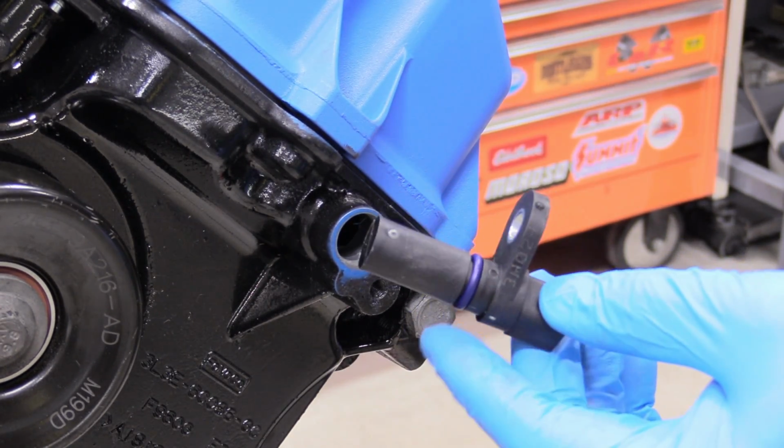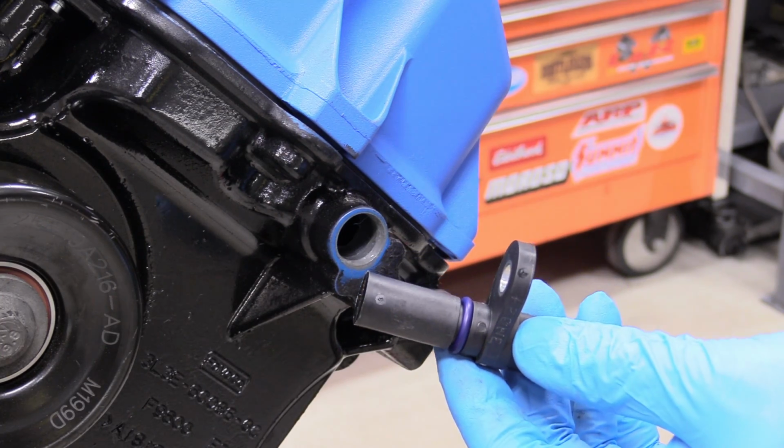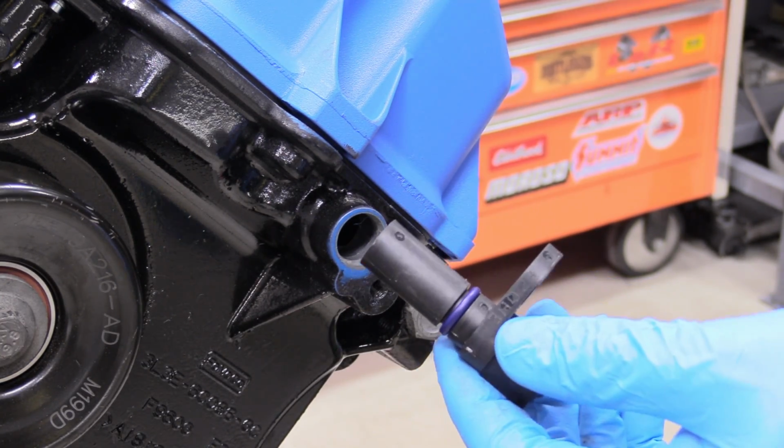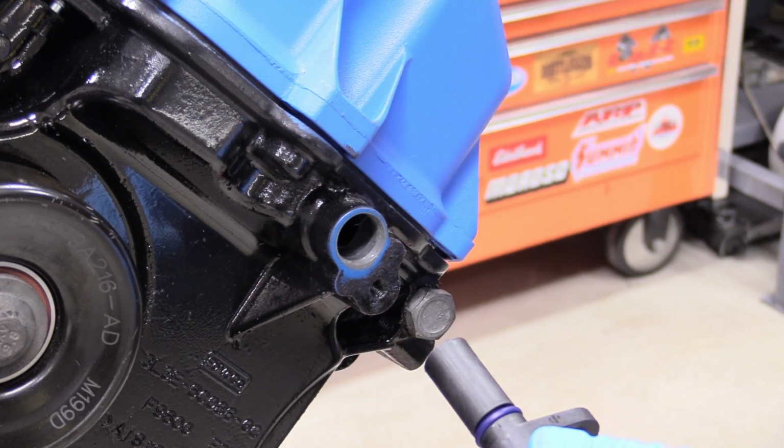So let's grab our old bolts and get to installing them. On this O-ring, the only thing protecting you from an oil leak, basically, is this O-ring. So if it doesn't sit quite right, it's never going to work. And the traditional thing to do is either take some engine oil and put it around there, or some WD-40, and I support that. Very, very good.